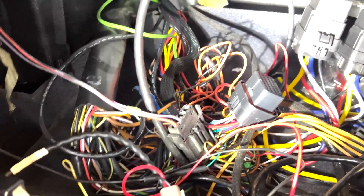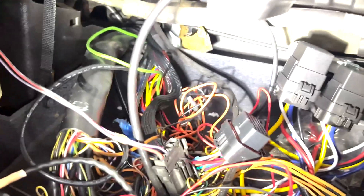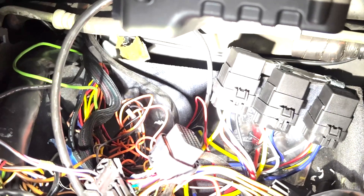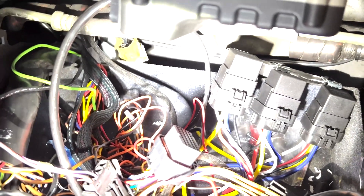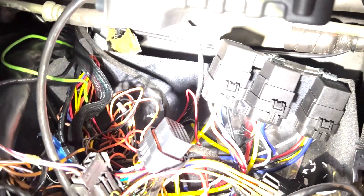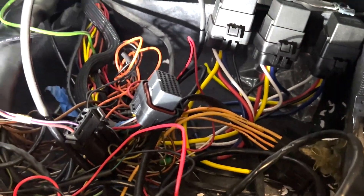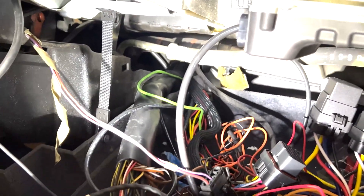So back inside the car — I'm not super happy with how the wiring is right now. I do plan on cleaning it up, but if everything works, I'm probably not going to mess with it too much — I'll probably just zip tie some looms together, maybe strip a couple of the wires that are just kind of mangled and not needed. Those are all the relays for the ignition coils — there are two relays, one per bank. Then for the MACH valve, I haven't run it off the same relay trigger because I didn't have a nice easy B+ to go from, so I just ran off another relay. Those orange wires go to a few fuses for the coils as well.